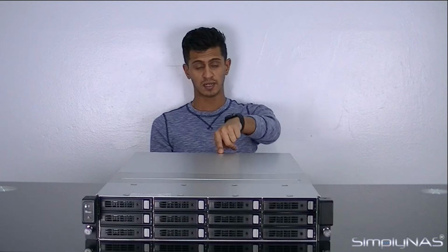You have 2 options on this. This is the U221 P21. That part number means 10 gig SFP+, whereas the U221 P20 will mean 10 gig RJ45. So you do have the option of base T or SFP+, depending on what your infrastructure is, of course. Switch you around to the back, so you can take a look at the back of the NAS, and I'll speak a little bit more further.